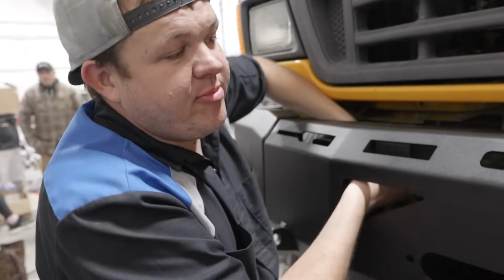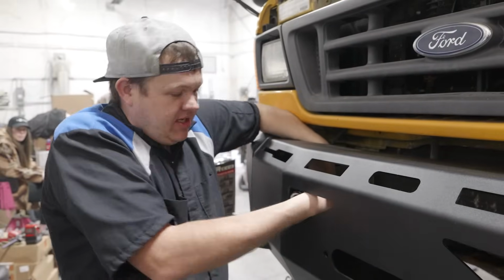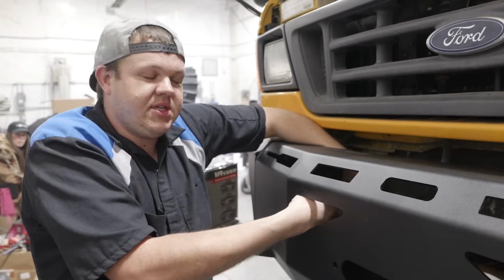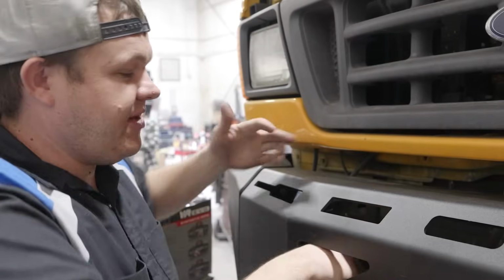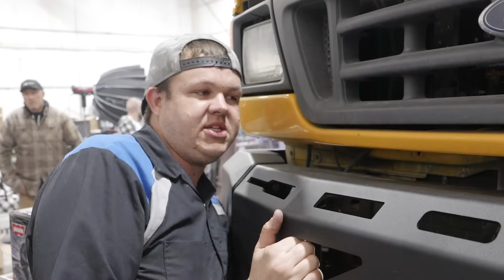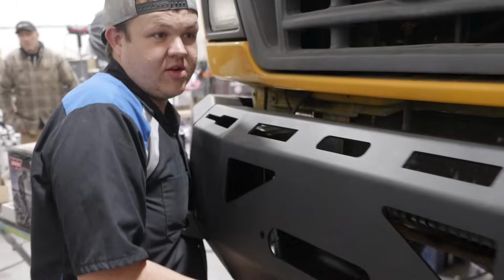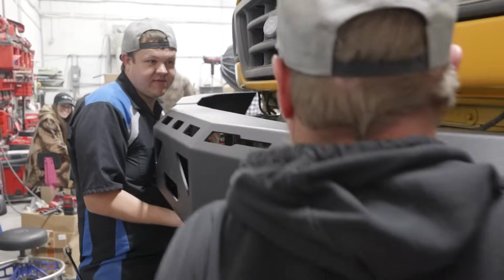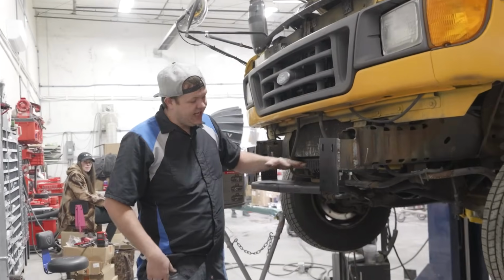All right, so on the back side of your bumper, we have 4 nuts with washers. So you want to loosen those up. In our case, it's a 3/4 inch nut, so we've got a 3/4 inch wrench that we're able to reach in and get it out. Yours might be different, so you might have to use a different wrench, but on this one, we're going to take the 4 nuts off, and grab somebody to help you and lift it off. Just set it down.